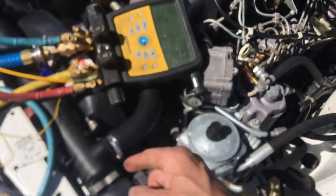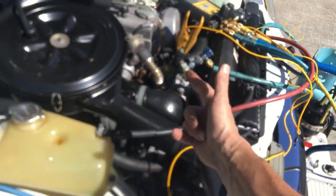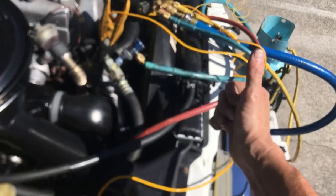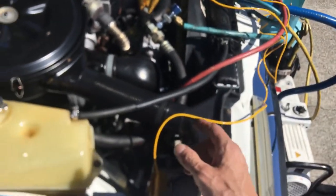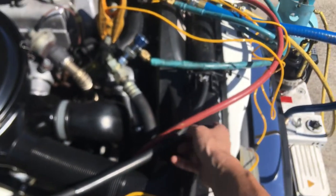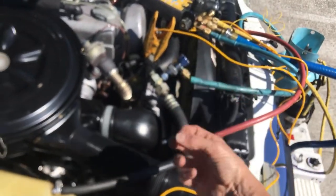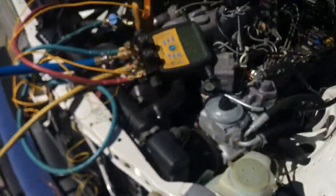Here in the summertime, I'm going to recommend they get a new fluid thermal fan clutch. It's not just about cooling the engine — air flow, air flow, air flow. Condensers are really sensitive to even a few hundred less CFM of airflow; it will greatly jack up your high side pressure and reduce the efficiency of your AC. When you have a thermal-driven fan clutch, just replace it — it's cheap, it's easy. I'm stressing it because I intentionally turned off the electric fan; I want this hot air from the radiator and condenser to heat up the bimetallic spring inside the thermal fan clutch — I want to see it engage. Alright guys, I'll see you later. I gotta get back over there to the Hummer.